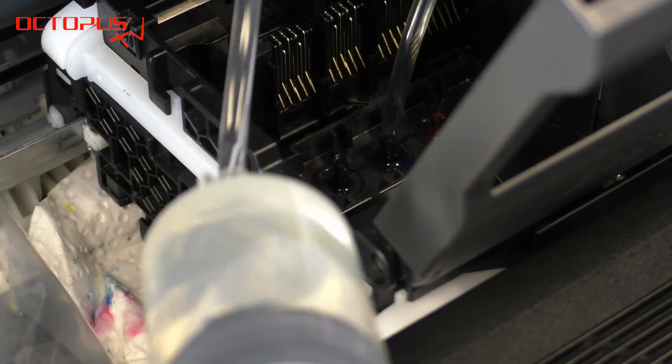By pushing down the syringe plunger carefully, the cleaner liquid flows into the printer's ink system. The first point of entrance is the ink port. From there the cleaner liquid goes to the piezo chamber, and finally the cleaner pushes out the ink through the nozzles in the nozzle plate fixed to the bottom of the inkjet cartridge compartment.